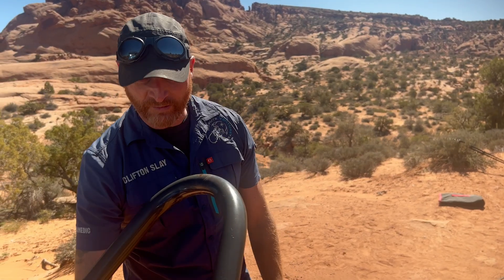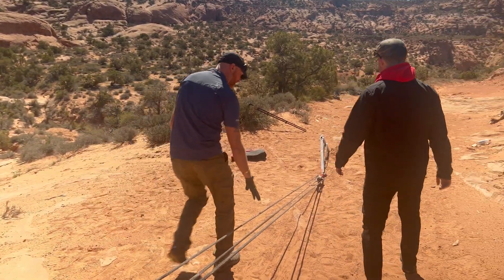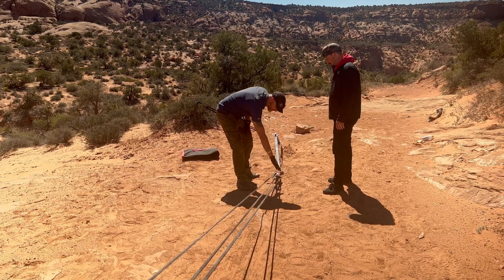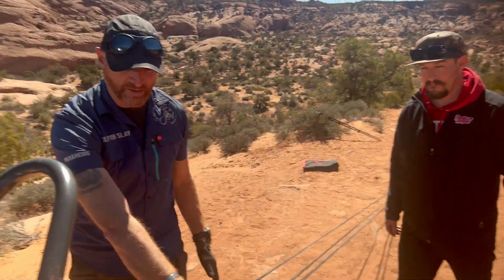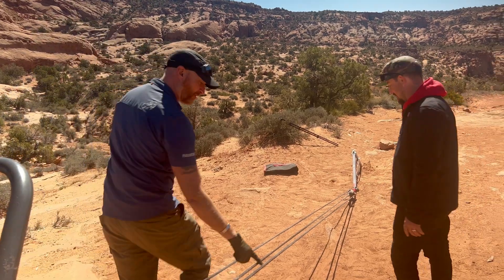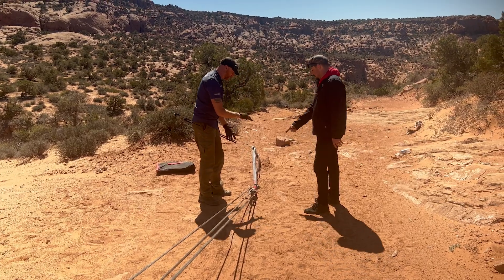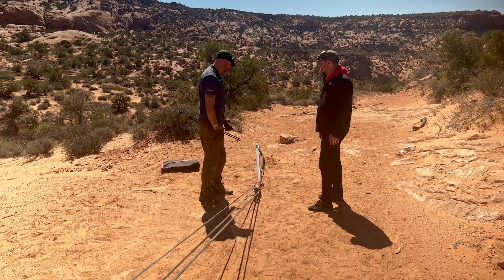Let's start at the point of origin, which is the Jeep. I follow this line coming down, go through the winch ring, coming back, coming through the inside of the winch ring — that way it safeties itself. We didn't cross the streams, or at least we fixed it. All the way back down, go back to a soft shackle, to the center of the ring. It looks safe, looks good. I think we're ready to winch.